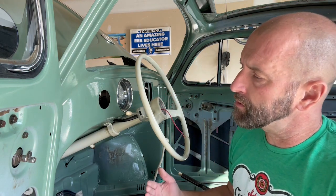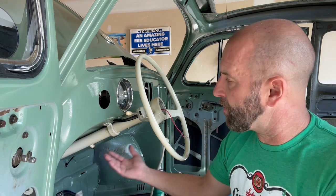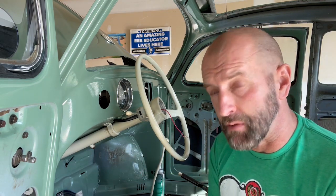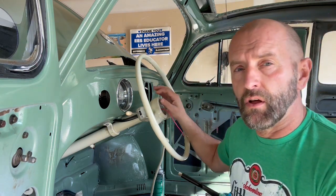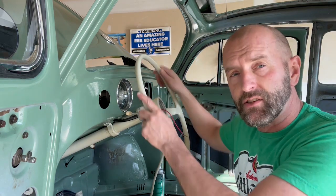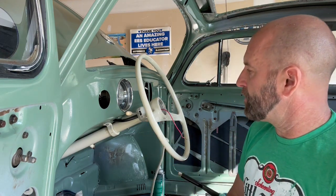The difficulty I had was a few things. First, it's important to know that this wire, although it's in red — that's on me — this is a ground wire. The horn on the '62 and earlier, that's hot wired. My '67, for instance, you have to have the key on to get the horn to work, but for these they're straight hot wired. You have to have proper grounding all the way up the shaft, and it's actually a little bit complex. The reason it has to come up through the middle of the steering shaft is that this wheel has to rotate, so if you have it directly wired to the steering wheel, that wire is just going to get twisted around and tear out.